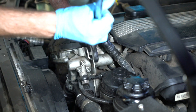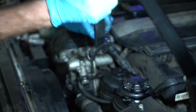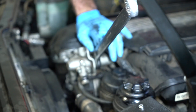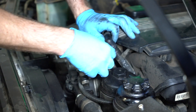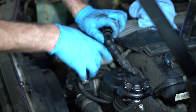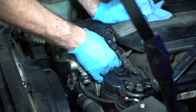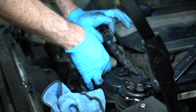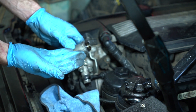I'm going to use a one-and-a-quarter inch wrench — I think it's also a 32. It shouldn't be on here too terribly tight. There it is, real nice and easy — set that off to the side. Let me get a rag before we leak all the oil. Before I do that, I'm going to unplug this VANOS solenoid so we don't twist that wire up too much. Cannot forget to plug this back in. It's unplugged and sitting right there. Let's go ahead and unscrew it — please don't puke out too much oil. Oh, it's mint.